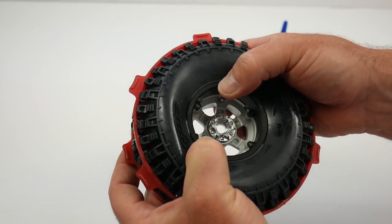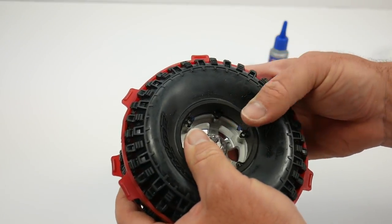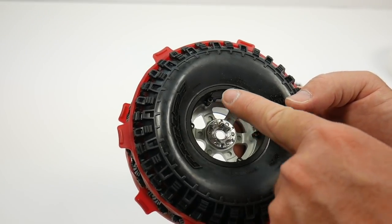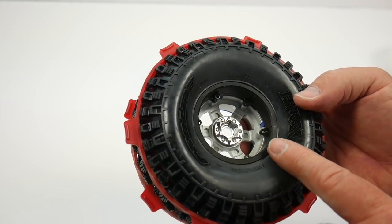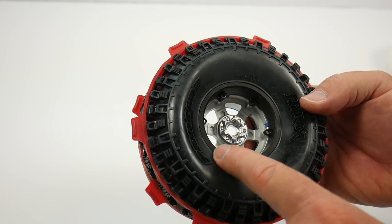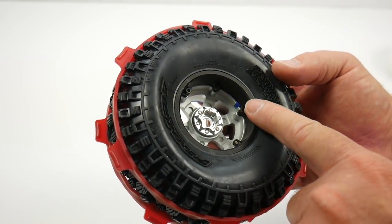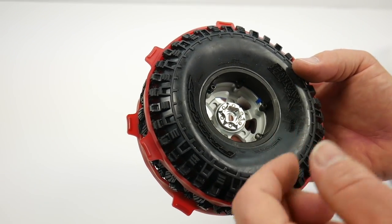As we look here, we're getting the bolt pattern matched up, and then once again making sure that the bead is capturing on that inner ring. Go ahead and pull it a little bit — perfect. I went ahead and got one of the screws started, just putting it in about a quarter way. I want to make sure that everything is lined up before I start tightening anything down. Just like your traditional one-to-one vehicle, you want to do it in a star pattern. I have this screw right down, then go onto the next one, then the next one, keeping rotating throughout the triangular portion of the six-bolt pattern here. Now that I have three bolts in about a quarter way, you can go ahead and tighten down these three bolts, get everything cinched down, and then add the final three bolts in just to tighten it all up.